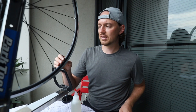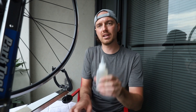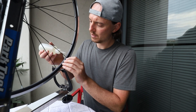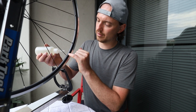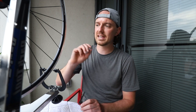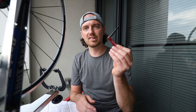I tightened all the nipples to the point where I can't see the threads anymore. The next step is to apply a little bit of lube to help when you tighten further — I'm applying it right where the nipple connects to the rim, not at the thread area. Now that the spokes are getting tighter, I can see them twisting because they're bladed spokes. I'm using a tool that holds the bladed spoke in place while I tighten, which prevents spoke twisting.